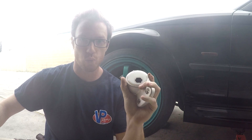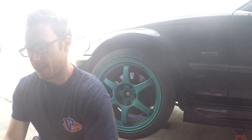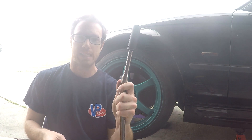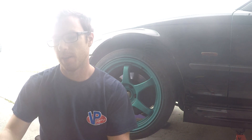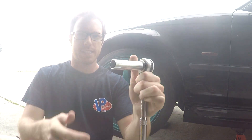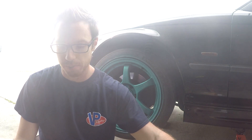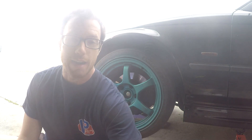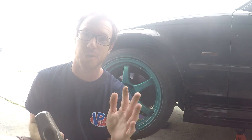So we have these brand new beautiful bushings from Condor Speed, but we're going to need some tools to put these in the car. From the look of things we're going to need a 17 millimeter socket with extension to get our wheel off, a ratchet — preferably a half inch because it's bigger — and a 16 millimeter socket for the carrier for the front control arm bushing. I also have WD-40 and my three-pound sledgehammer in case we need it, but hopefully we don't. So let's get to it.